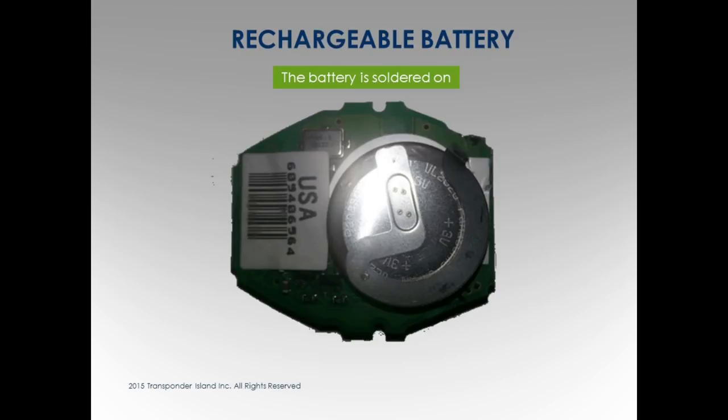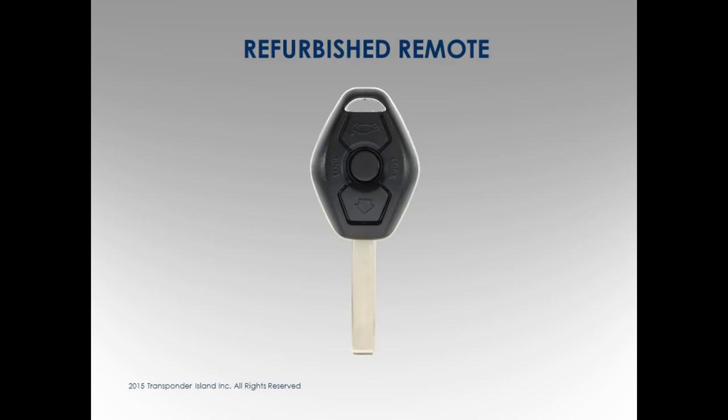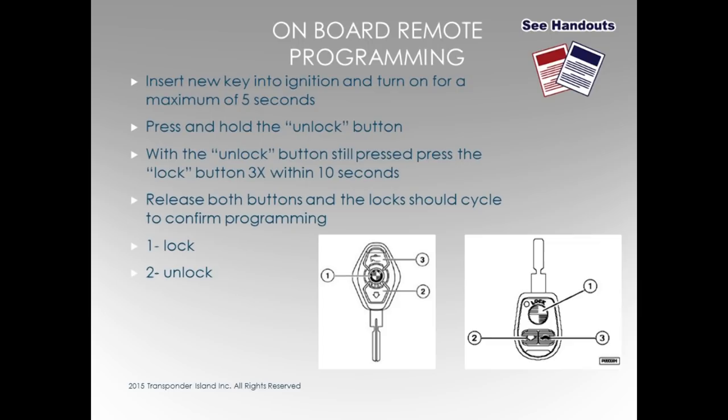And you've got your new one, brand new. Just before you cut the key out, put it on your RF test pen and test it. You're getting your frequency coming out of your remote before you cut it. Otherwise you're gonna cut it and you'll get a problem. They do go dead and they won't pick up. So test it first. As long as you're picking up your 315 frequency, you could do it. The battery doesn't charge.